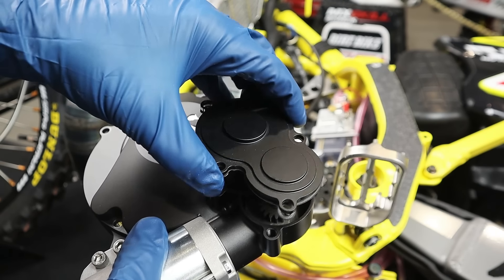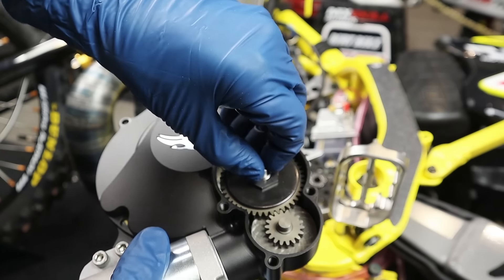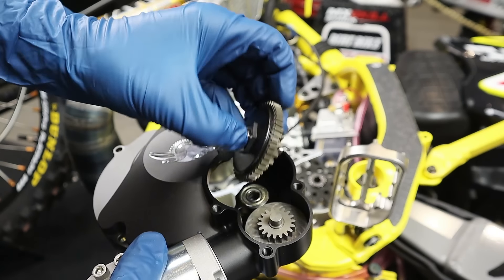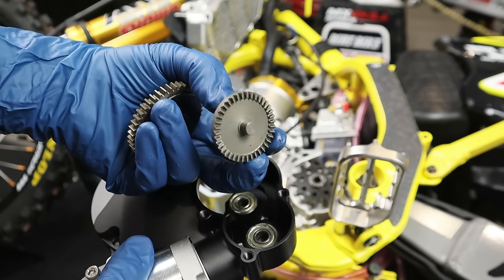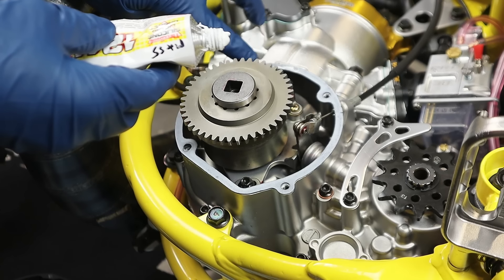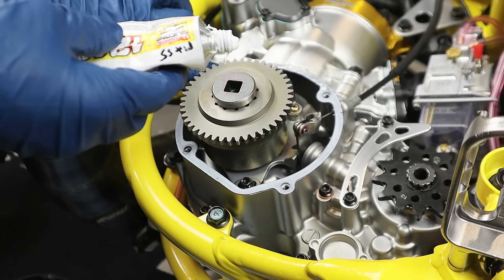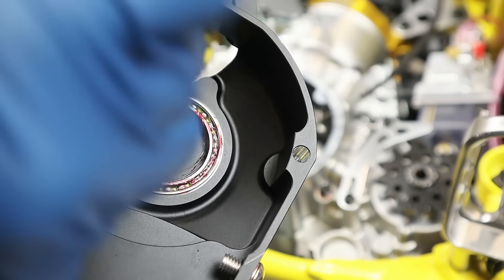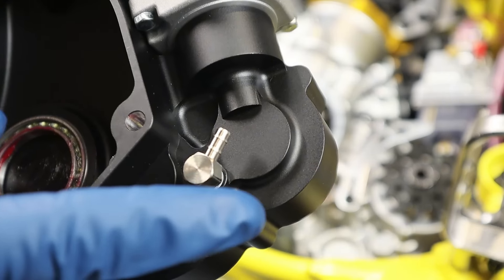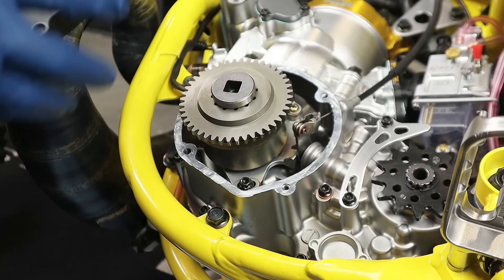Pop this cover off — don't drop your gasket. You've got the cover with some bearings and gears in there. Take the gears out — this one here will rotate the assembly bolted to your flywheel, which is driven by this gear, which is driven by the starter motor. Pretty slick. Going back in with a little more 1211 on the gasket — you can also dab some on the back of your Panthera e-start cover too. As you can see, the center bearing has lots of grease inside the rollers, which is awesome. I'll give it a little more Maxima anyway.